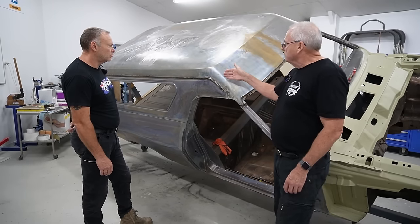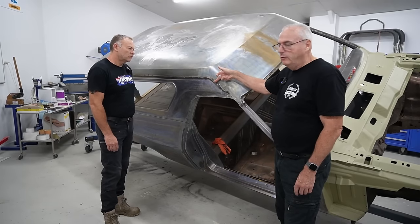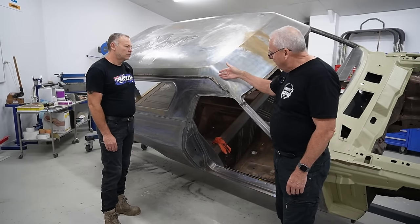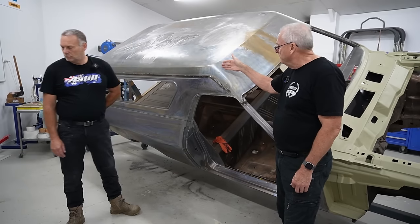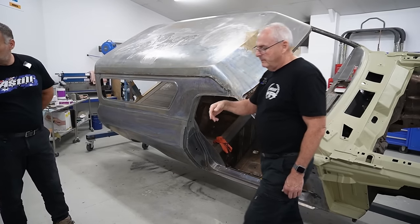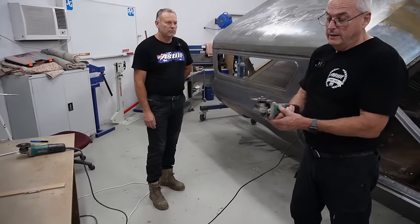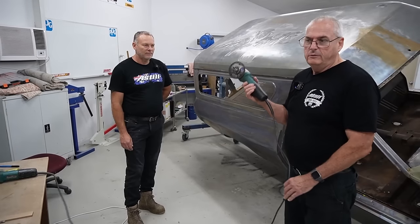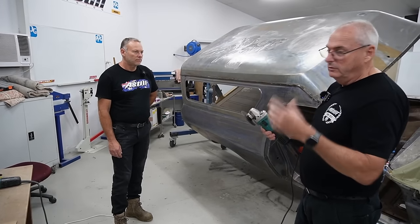And we've had a good look this morning. I need to save this drip gutter so that I can get it remade. So we've made the option and he's run the blade. Which one do you end up using, mate? The bigger one, yeah. People always say you shouldn't use it without a guard. If you do this sort of work, you'll get no work done without it. You just have to wear your safety gear, your gloves, your shield.